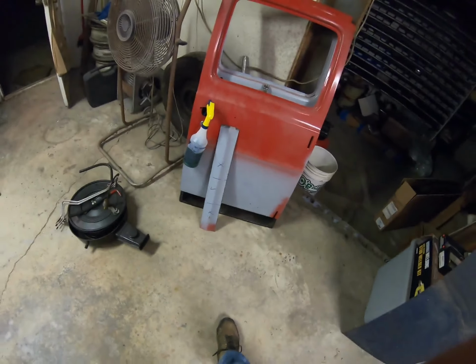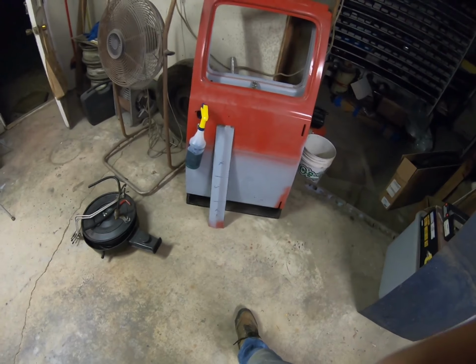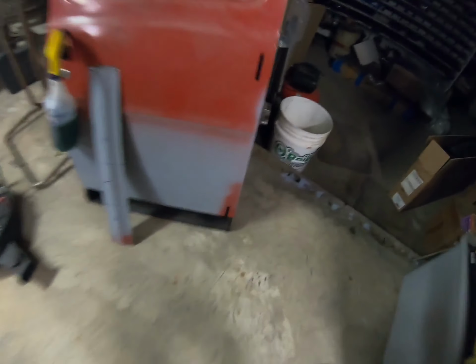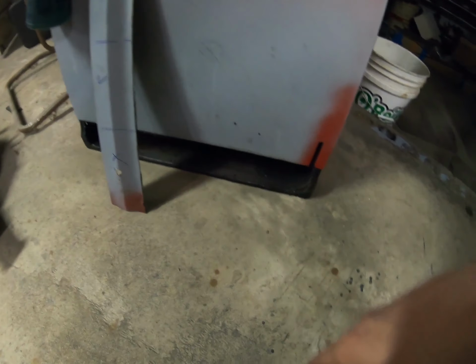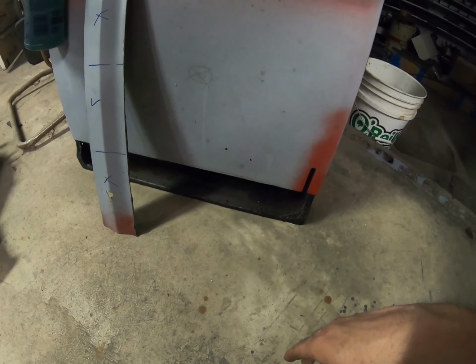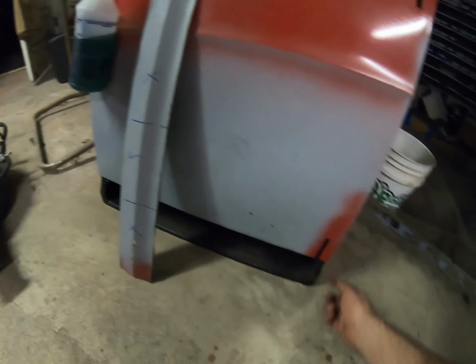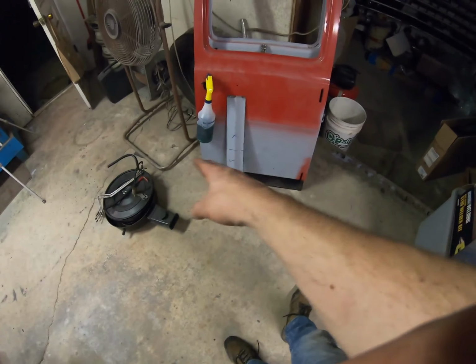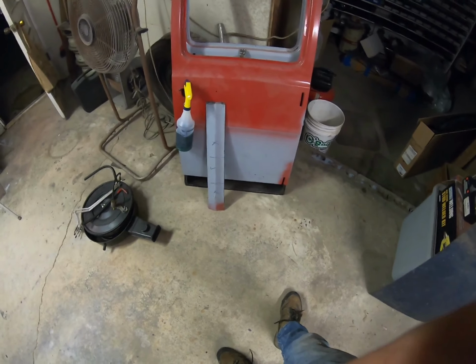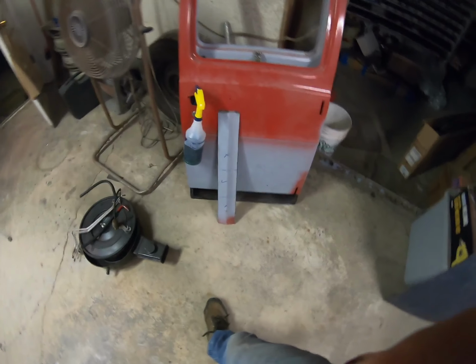And we have hopefully a solution for this. What I did was I cut off the skin here all the way around. I just ground it down in a matter of about 2 or 3 minutes, and then was able to just pop this off and then take the rest of the lip that wraps around the back sides like you're familiar with there. Okay. And I used our rust stuff, so we've gotten all the rust off of it, and there was rust on that lip.